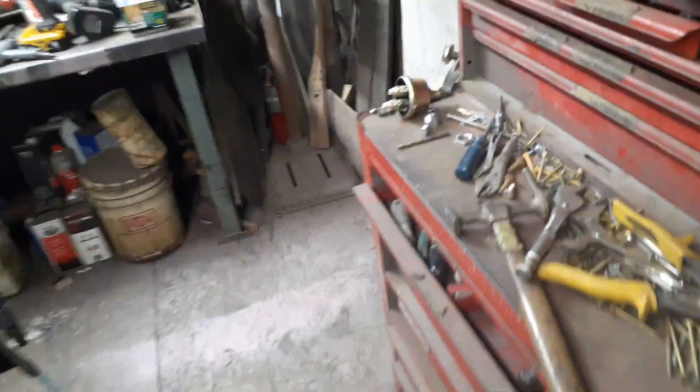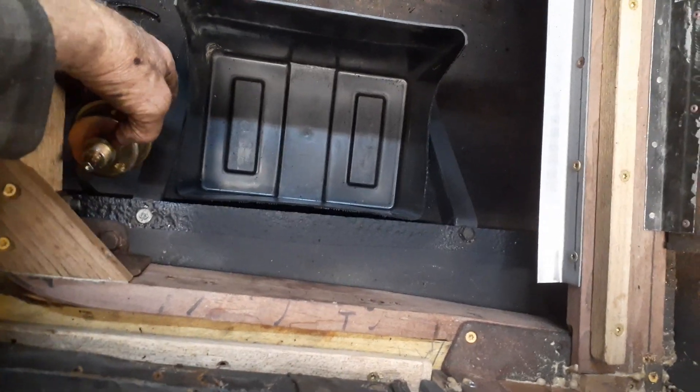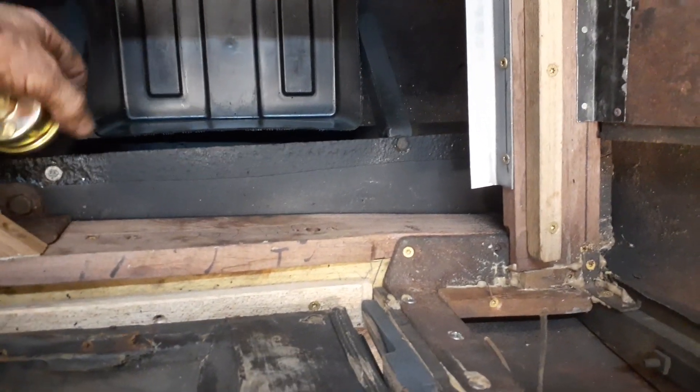I am going to put a battery on/off switch, which is right there — I always put one on every car because I don't trust the electrics in these things. That of course is going right there under the seat; I made a bracket for it. There are the batteries, and this is going to have a sill in here like a toolbox, so you just lift the seat up and flip it and sit the seat back down. Most of the ones I've done I put the switch on the firewall, but this one doesn't have a firewall I can use because it's a straight up-and-down wall. The exhaust is on that side, so I have to put it under the seat — but that'll work.